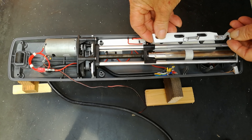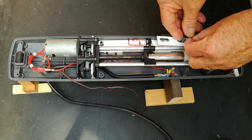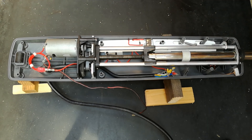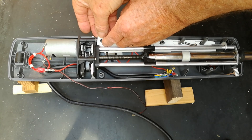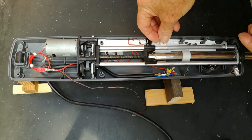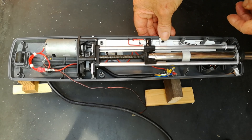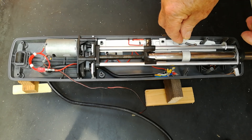Here you'll see me adding three small plastic wedges. This locates both the base and the sliding trigger to stop it from popping up and keep the correct pressure down on all the parts. There's the rear wedge, the center wedge, and then there's a wedge that goes across the post which has the added job of holding the return spring down at the same time. These all just slip on.